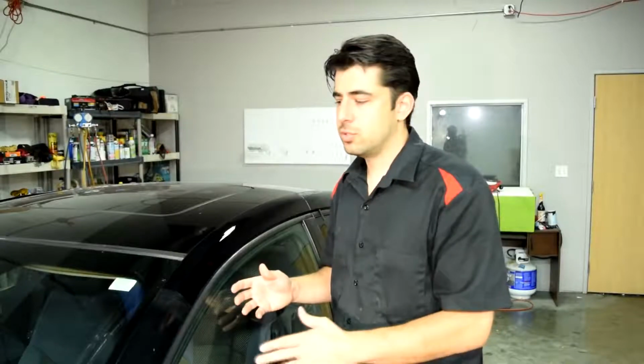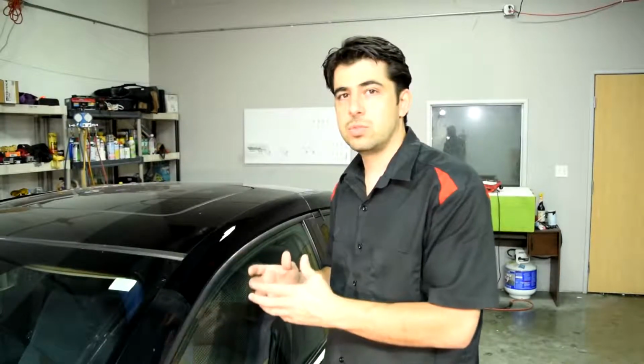And here's how things look in our blend area. We've still got a bit of a line here, but this is not too bad. We should have no problem blending our new clear coat into our old clear coat. But in order to be able to do our blend, we're going to have to wait at least 48 hours for this clear coat to dry and harden.